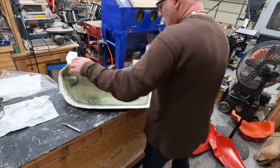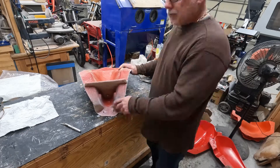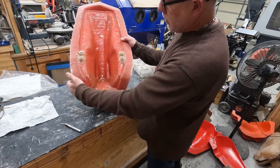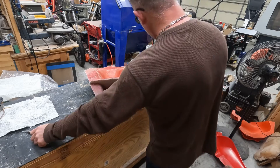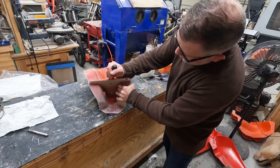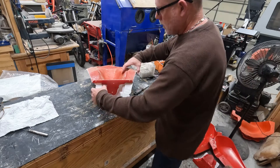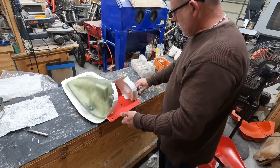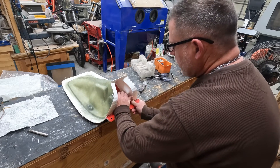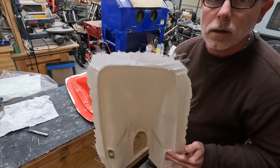We'll grab that and again do a little speed motion — there's only a couple bolts on this. We have all the bolts out, exception of this bottom one here. The flange bolts are out of the mold, and these flange bolts here too. Again, we take the putty knife and get it in between the mold flanges. Voila — there's that part. You may want to do this with gloves — I have gotten myself with some slivers in here before. Basically I just lift and break the part free from the mold. Voila — comes right off, pretty as can be.